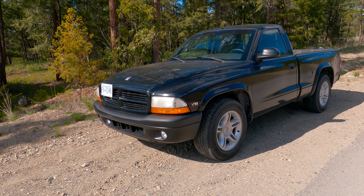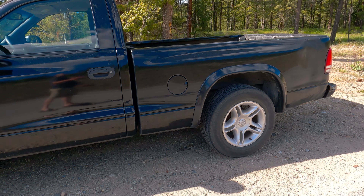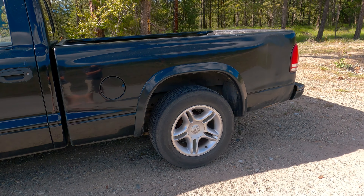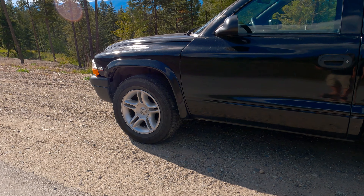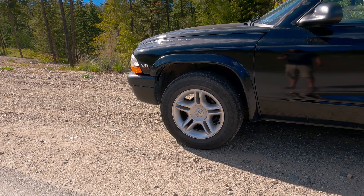The biggest thing I've come to realize is that it is all about tires. I doubt that the suspension improvements are going to have much effect on tires sticking to the road. With autocross on a flat parking lot, you're right at the limit of what tires can do. These are some Goodyear Fortera HL tires — not even remotely something that would be considered a handling tire. I put these on recently thinking they'd be better, but there's really no difference in autocross. Anytime I hit the gas, the rear end wants to spin. Going through corners, the front always wants to slide. I've got major traction problems out there.